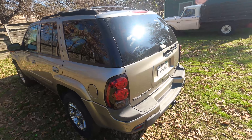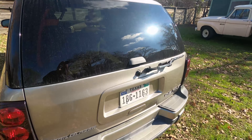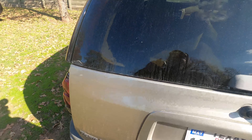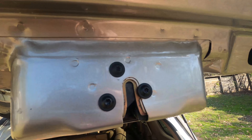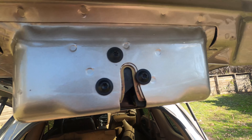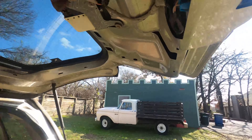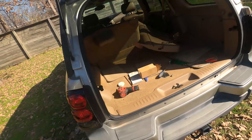What we got going on here is the rear hatch does not lock or unlock, so we need to swap out the lock actuator. I've already kind of started, but it's real simple to get to this point. This is the lock actuator - it's held on by three T30 Torx screws and it goes in this backside here. I called O'Reilly's and they wanted like $250 for this door lock actuator. Amazon has it for 26 bucks - I'll have a link in the description for that and for trim removal tools if you need those.